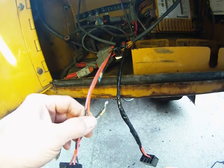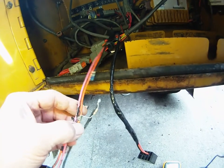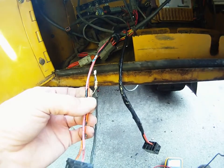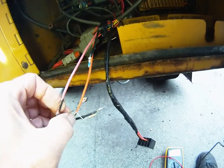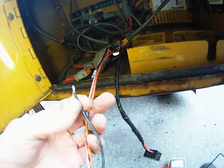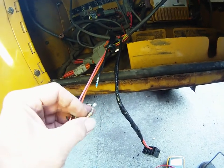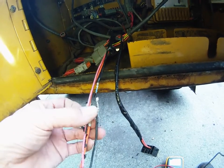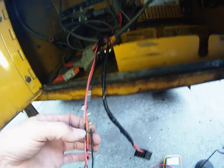On the positive side we still have a factory setup where they put a crimp terminal and probably a quarter watt or eighth of a watt resistor — a 5k ohm resistor — and that goes into the black wire for our bridge.